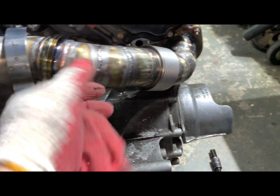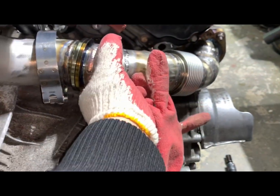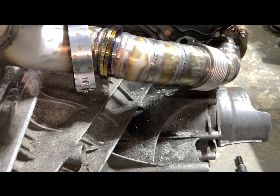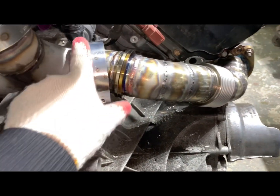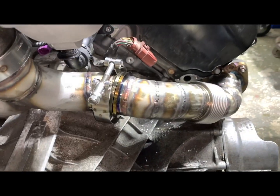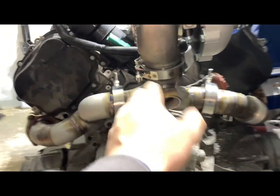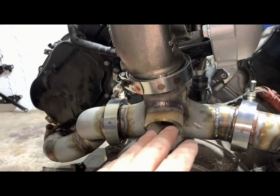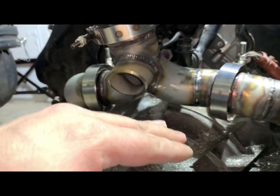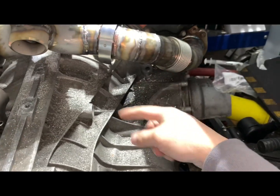Don't force it into the flange — if you're forcing on the flange, that means you have to redo it. It should fit perfectly, and then you're not going to have any issue with cracking and other stuff. This one is all done. The manifold is done at this point. I don't want to put the wastegate on yet — I'd like to do that when I put everything in the car, so I can set exactly the location of the wastegate somewhere around this area.